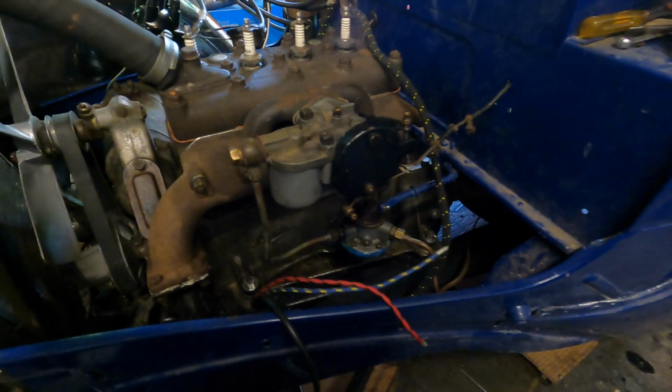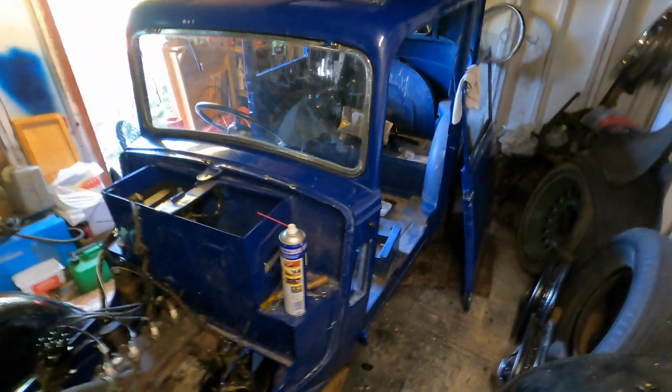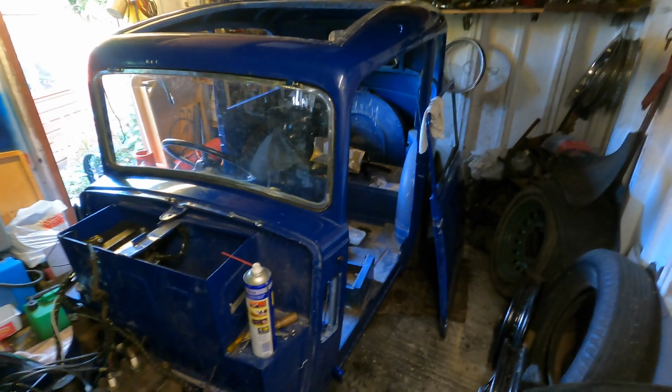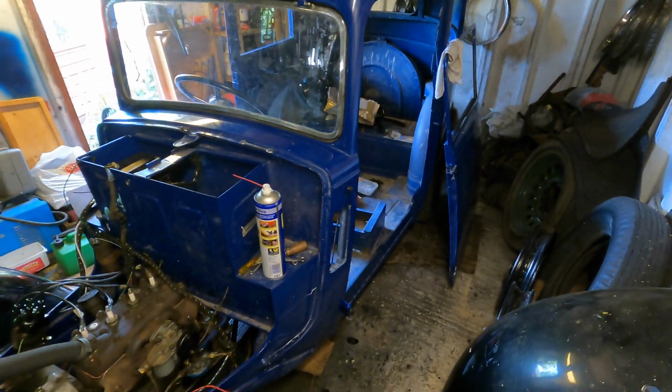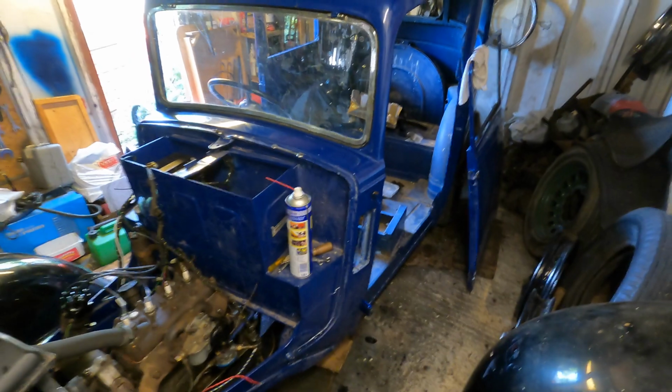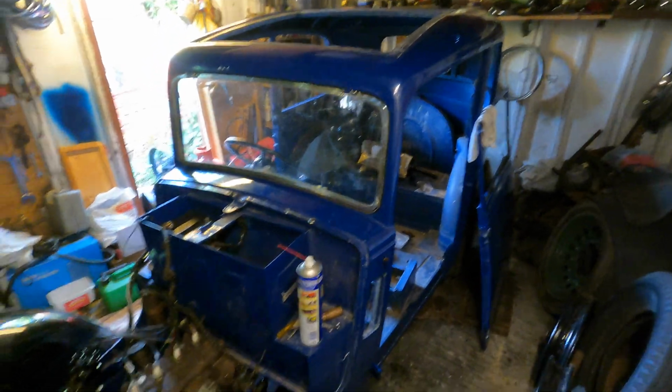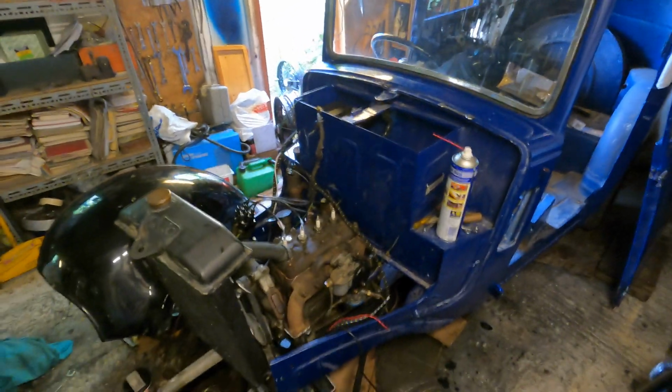That's down there. There's a couple of our wires for the headlamps on this near side, and the exhaust pipe. We found the exhaust pipe was actually in the way. It was, yeah, it was fouling. We had it the wrong side of the axle. So it goes up and over the axle nicely now. We had it the wrong side of one of the cross members. It actually goes through a cross member on the chassis. We had it underneath it. So we've rectified those bits and got that as it should be.